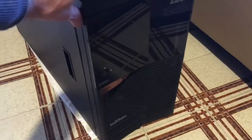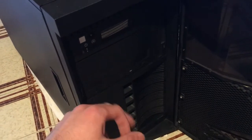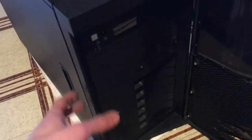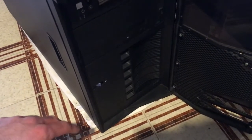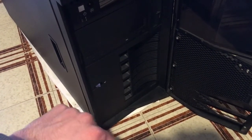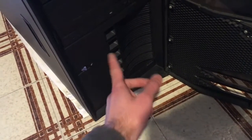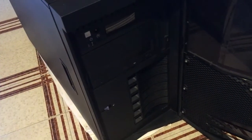On the front we have a nice door that's the same as the eServer, minus the badge. Here you have the operator panel, floppy drive, and a CD drive which is actually IDE. This is a drive cage. This entry-level model retailed for about $13,000 in 2002. It's the baseline, so it does not have a drive backplane — all blanks, with no backplane in the back. The only hard drive present is an 18.2 gigabyte drive that sits behind the operator panel.